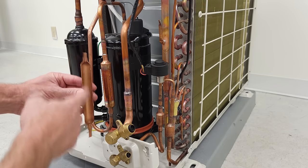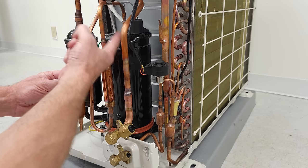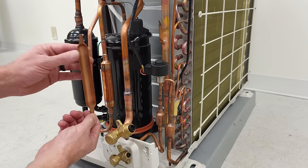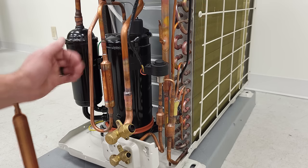It's just a hollow chamber — a place for the refrigerant to gather. Each of the pulses of refrigerant coming from the compressor can hit the walls in here, reduce in vibration, reduce in frequency and noise, in order to not have the whole thing shaking around and creating a high-pitched noise.